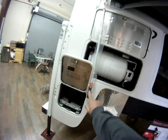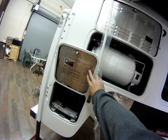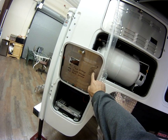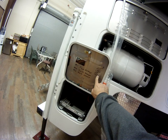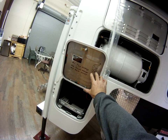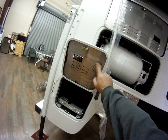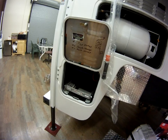Here's a great illustration of the battery setup: dual six-volt batteries in series. The rear battery negative connects to the negative in the camper. Then you have a jumper from the positive to the negative, and then the camper positive is hooked to the front battery. So that's in series, giving you 220 amp hours — essentially a giant 12-volt battery made from two six-volt batteries in series.